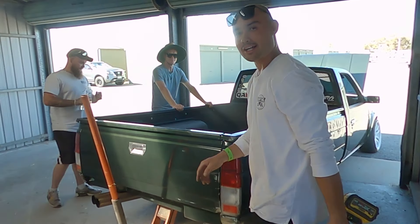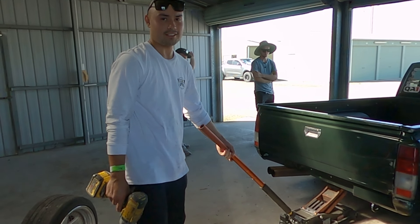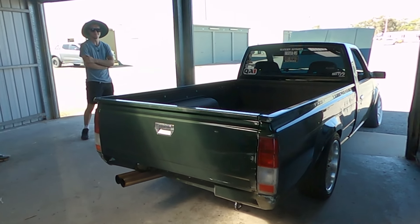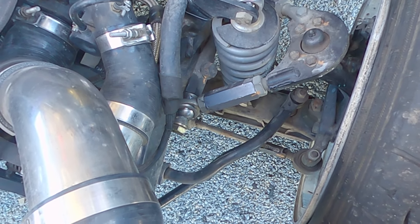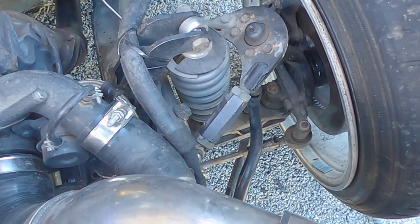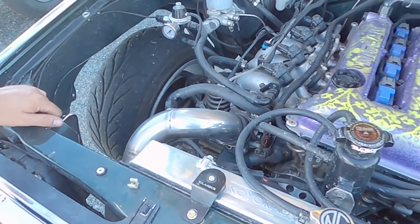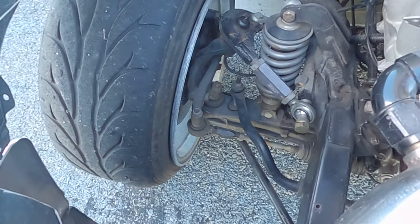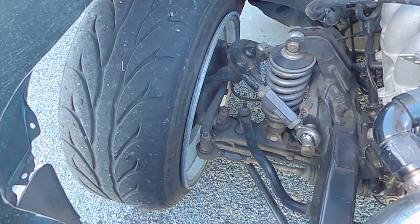So what is this thing? T25 Navara. And what are you doing for the rear end? Nice little stock setup, leaf sprung, with a nice little bar in it. Navara leaf sprung rear. So like a custom top arm? Yeah, they're from America — Cold Hard Bodies. And what about steering lock mods? Cut and shut knuckles. I had a shortened WRX steering rack end, like WRX steering rack tie rods. So everything's like custom — but still Navara front end? Just a lower control arm, not the spindle and stuff like that. Yeah, everything else has been changed.